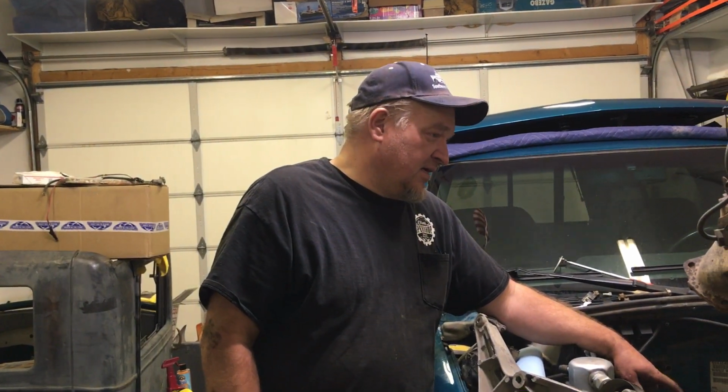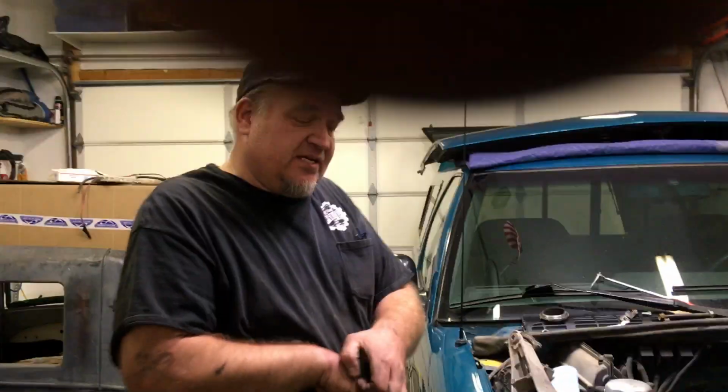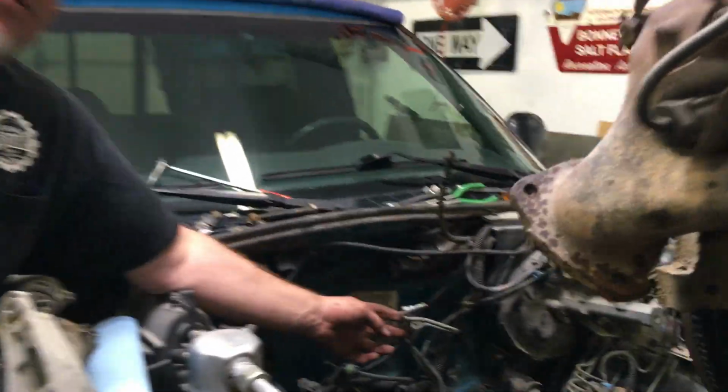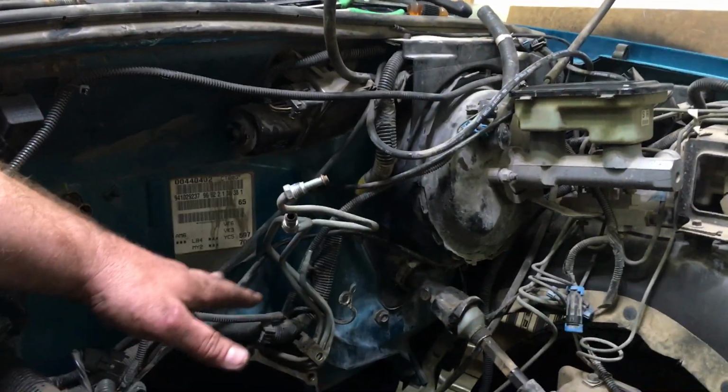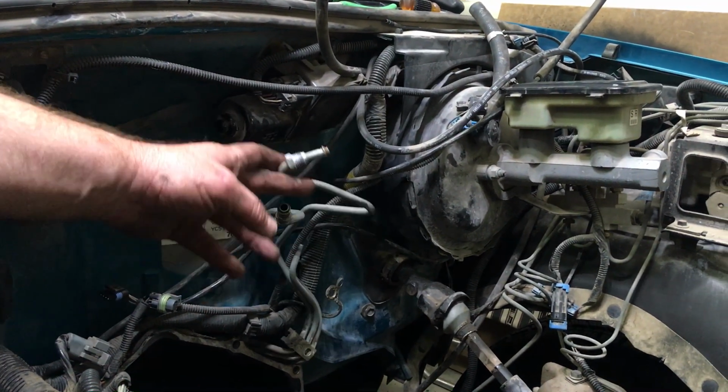So, where else are we? So that's my suggestion. Raise the body up, get you your 4 inches that you need, then you can pop it out. Right here, concern, these are your fuel lines. Now they come up and over the motor, so as you're lifting these up, you can see they're quite flexible,